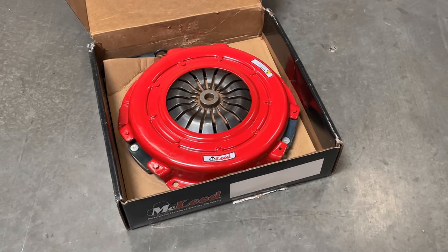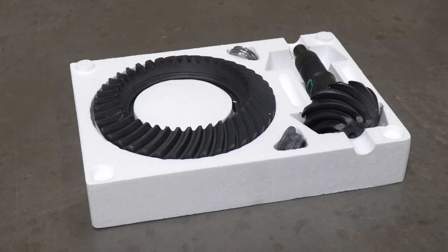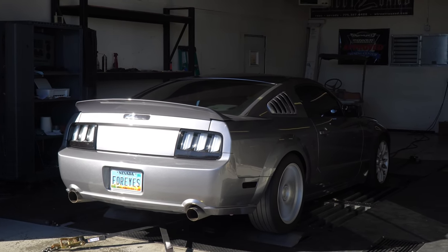We just don't lose and give up, so here's what's going to happen. I'm going to upgrade the clutch so I can power shift like a pro. I'm also going to have 3.73 gears installed so I'm not doing airliner speeds in third gear. I'm going to increase the redline to 7,100 so when I upshift, the Mustang's RPMs fall back into an optimal spot in the power band. And I'm going to do my best to squeeze an extra 14 horsepower out of this thing to get it into the 400s. Then we'll run this race back and see how much of a difference those changes make. So if you're interested in seeing how all this plays out, you know what to do, and I hope you come back for the next one.